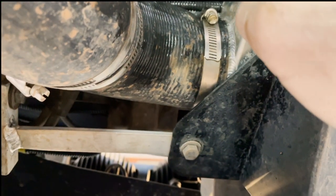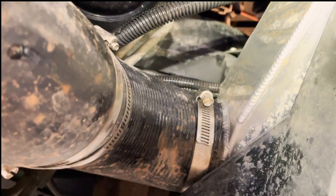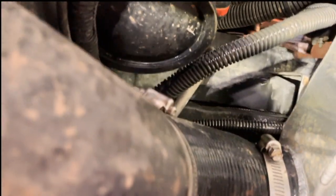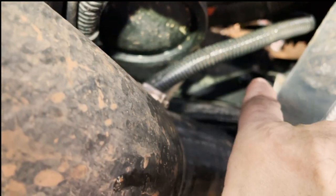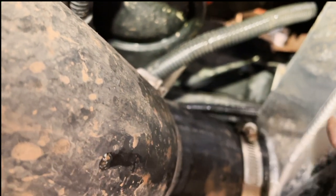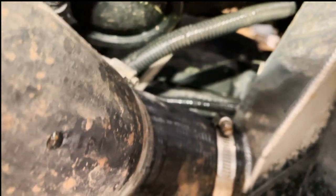The idea was not to have that touch. I've got it secured to the top fin and down here with these two L brackets, and some simple nutserts. It's hard to look in here because you've got the intercooler in the way, everything else. But that's what I'm after - just two of those L brackets, get those screws out, and I can lift that fan shroud out. I've got to give some sort of gasket up to the bottom of that.